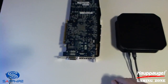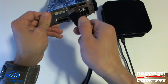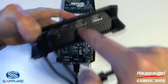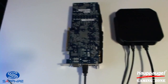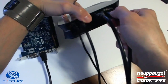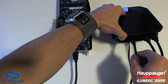Alright, boom — that's hooked into your PC. Very easy. The hardest part here is getting your HDMI set up, and that's not hard at all — I'm actually kind of being satirical there. So what I'm going to do is hook the HDMI into the video card. You only have one HDMI slot on the HD 7970, so you plug your HDMI in right there. Wiggle it in. What that would normally do is run out to your monitor, but instead it's going to run into the HDMI in slot on the HD PVR2 — plug that into the in slot, it's the one on the left if you're holding it up. Next, you're going to need another HDMI cable. You have one more HDMI slot on the HD PVR2 — plug this into the HDMI out. Now this is going to run out into your monitor, so your video card will feed into the HD PVR2 and then out to your monitor.